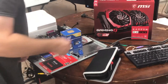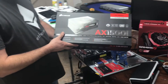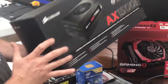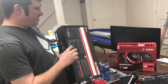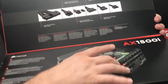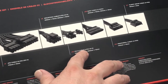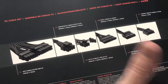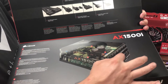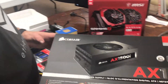Don't spend a lot on your keyboard or mouse. You'll actually laugh — these are PS2 connectors. I didn't want to waste USB ports on them. This is the Corsair AX1500i — a 1500-watt titanium power supply. It comes with all of these cables. Just for example, it comes with 10 PCIe cables — we'll only need six when we're absolutely maxed out. We also have 20 different SATA cables. It pays for itself just for the cables and the cable management it allows. It's very compartmentalized — you can use only the specific ports you need. They've done a really well-done job on this.